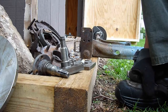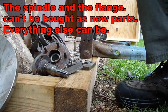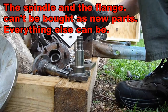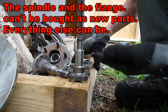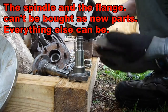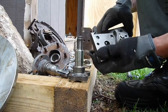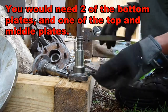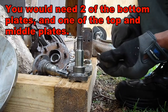So there it is — real simple install. You don't even need to go to the junkyard if you don't want to, but the spindle would be the only key part you'd need to get. I'll post this up on the website at turbododge.com to give you the dimensions of these plates. This is only a tool, so you'd need one of these and two each of these. You can get these cut at a water jetter — probably run you a hundred bucks for the pair, two sets.